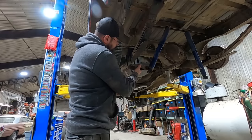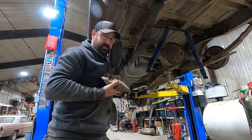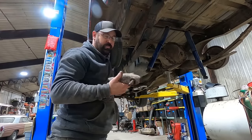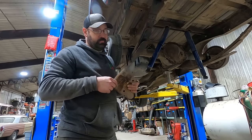That is going to be a problem. I think the shock length will be okay. You know what? We're not going to reuse these on another Mopar application. Anyway, what I'm getting at, 7/16 hole, 1/2 inch bolt. We'll just open up that hole. We'll get our reamer out.